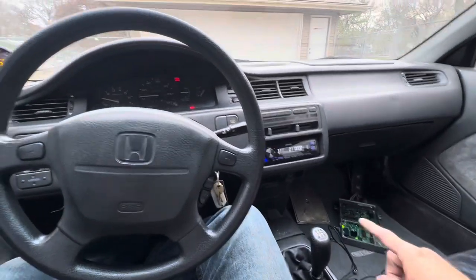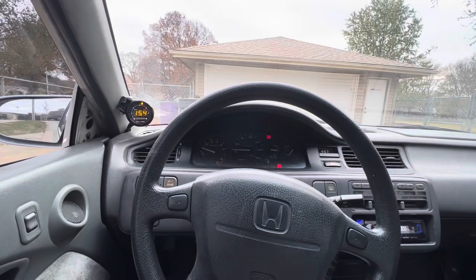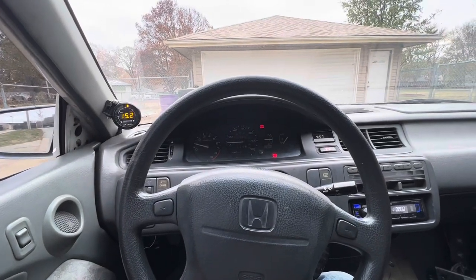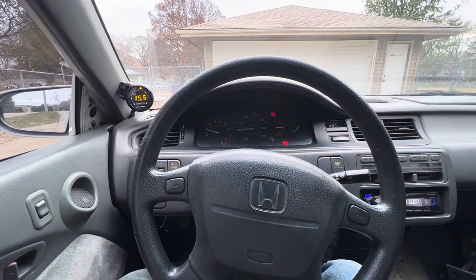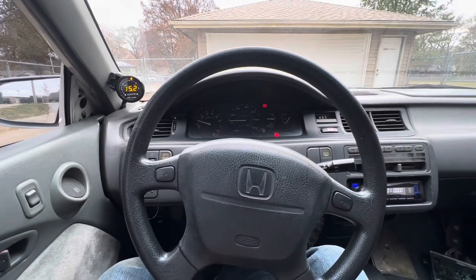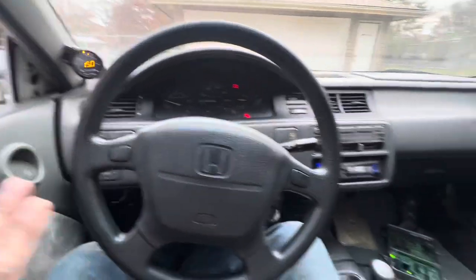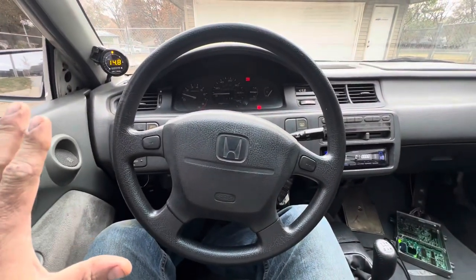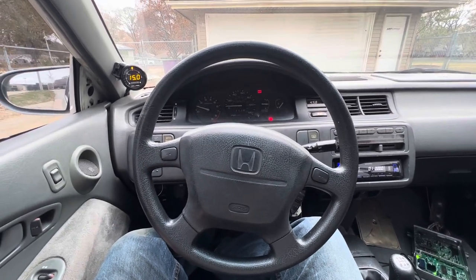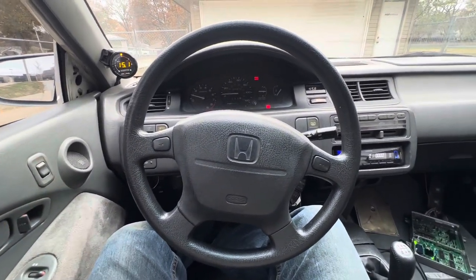Every other time I've had this V1 in here, it has the red light issue, and the air fuel always reads really funny. Normally sitting here at idle, it would always read like 11.5 air fuel. And I'm like, there's no way this thing's running at 11.5 air fuel. I played with the tune and I would pull fuel out of it, and if I got it up into the 13s, it just acted like it didn't want to run at all. But now here we are, it's showing 15s, same tune. It's the same thing I've had in this S300 V1. Now it's idling like high 14s, low 15s, which is a little leaner than I would like. But before, like I said, it was showing like 11s. So I just left it there and it seemed like it idled good.